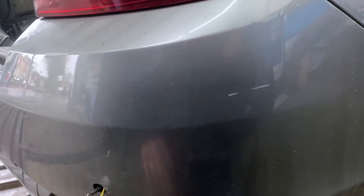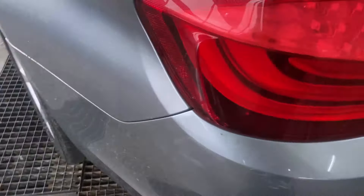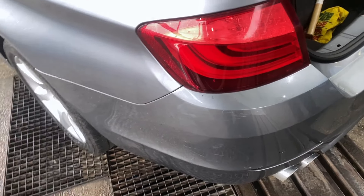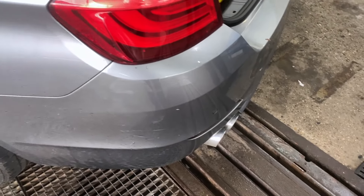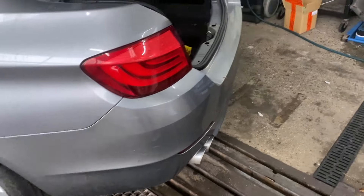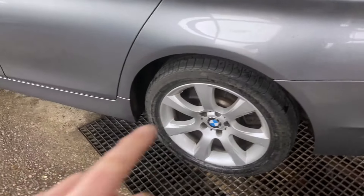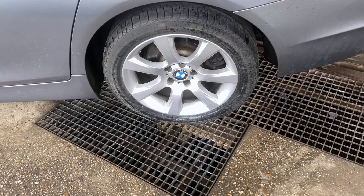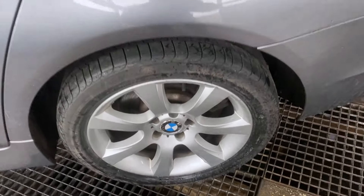These bits here we can do a cosmetic repair on - machine this and touch it in, it will look about 60 percent better but the colour won't be perfect. We'll do it with a close match; even with the correct colour it still won't be right, so we'll find a grey that's a fraction darker as it will look better. This side will machine a bit more - there are a couple of bits where the paint's gone through, so you can upgrade if you want. We could have it ready for Saturday afternoon. You'll also need a set of wheel centres - you can buy them online or get the correct ones from BMW.